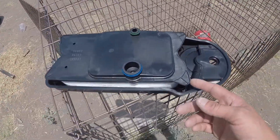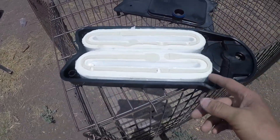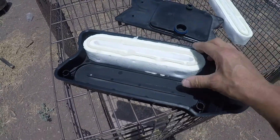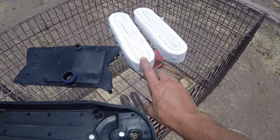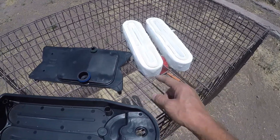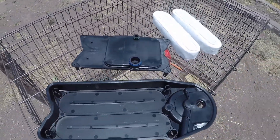This was very easy — a flat tip screwdriver just worked around it, this popped off, and then same thing, screwdriver in here, a little bit of pressure, boom, these just popped off. What happens is these get plugged up — it's like an oil vapor separator, it's designed to trap the oil and let it drain back in and the vapors pass through, but eventually they get clogged. You can't just take the filter out and delete it that way because...